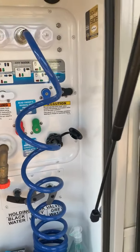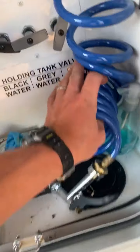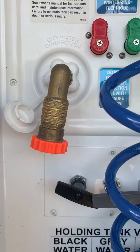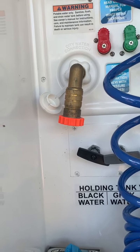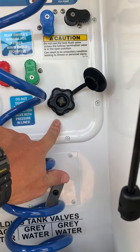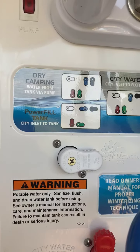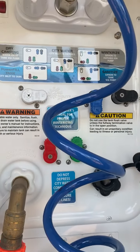This is the outdoor little spray hose here. Here's your two gray tank valves and your black water. This is a must - it's a regulator to keep pressure down on your pipes. Some campgrounds have too much water pressure and that regulates it. Here's the black tank flush - just hook the water hose up here, open that black water valve and she'll flush right out. And here's the valves for dry camping, city water, and winterizing - it's all color coded.